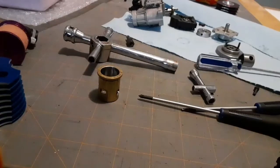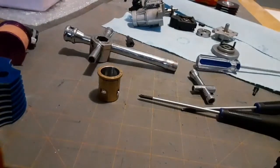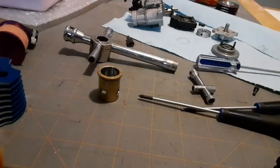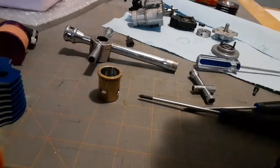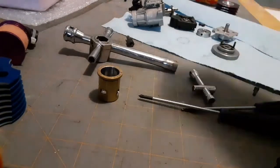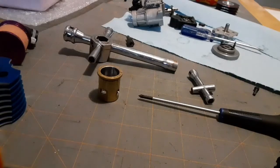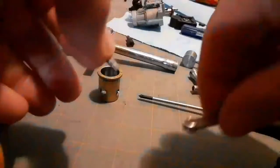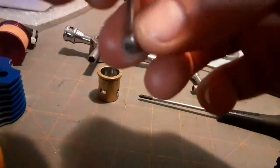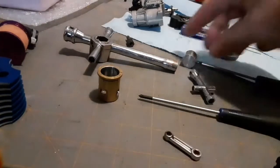As you can tell, these motors are really simple to take apart. I'll do another video putting it back together. You can see this motor of mine has almost no wear. I bought an upgraded motor for my Shockwave — the carburetor was goofed up from the factory, it was a Chinese supplier, so it was easier to pull the carburetor off my older VX-16 and tune it. To get the rod out, there's a wrist pin. Some of these will have a clip on the end, but it quite literally just goes in like that. That's your wrist pin right there — interesting setup for sure.